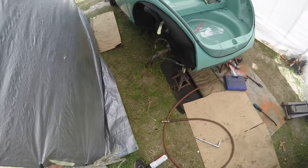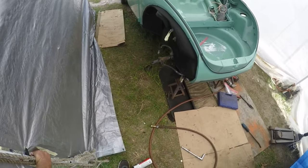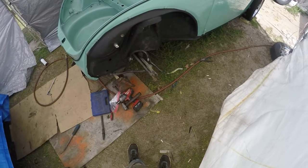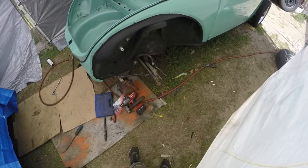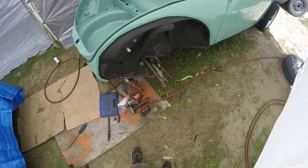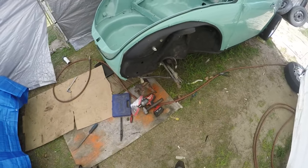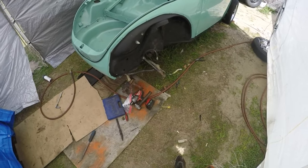I have the struts and the whole assembly — they're brand new. They've been assembled onto a chassis and somebody never used it. I'm going to sandblast the rotors and then have them turned so they look brand new, disassemble the entire strut, sandblast all the parts I'm going to reuse, and buy the lowering kit. I'm going to lower it an inch to an inch and a half — I haven't decided yet.